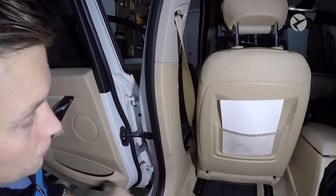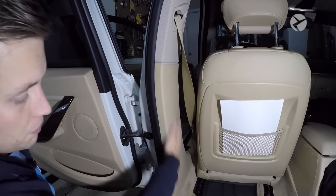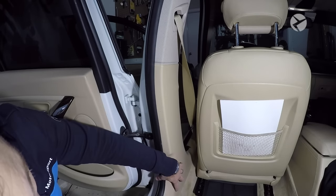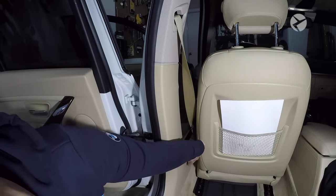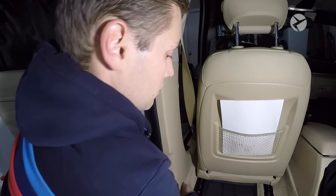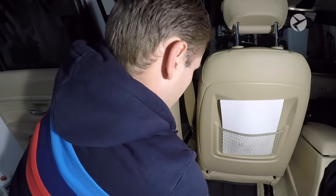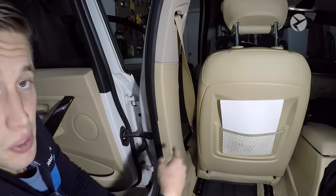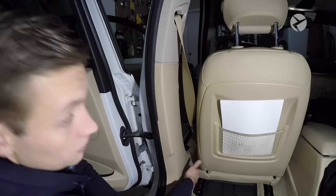While you're here, you want to remove this piece of plastic that guards the seat belts. To do that, you just have to release two pins — there's a plastic pin about right here and there's another one over here. Take your hands underneath and pop this side up, and then once we get to the front, go ahead and release this clip as well.